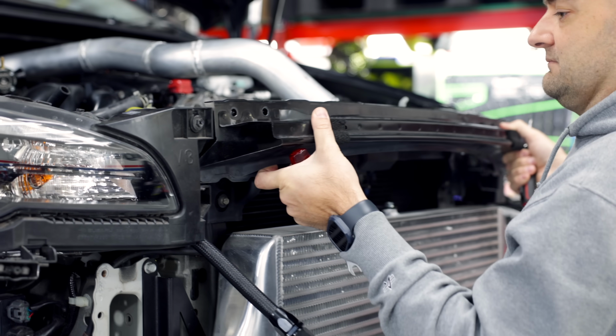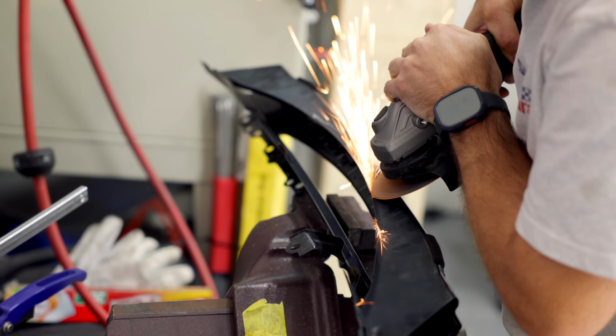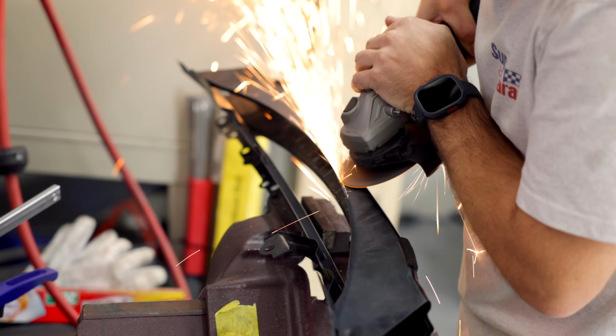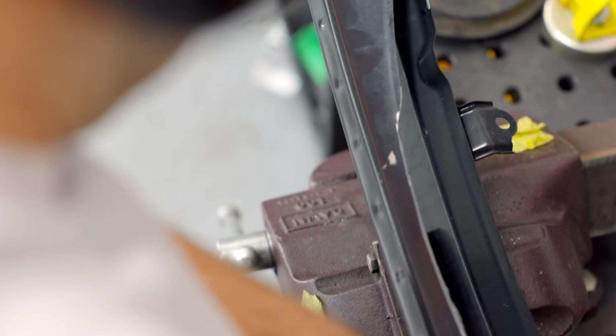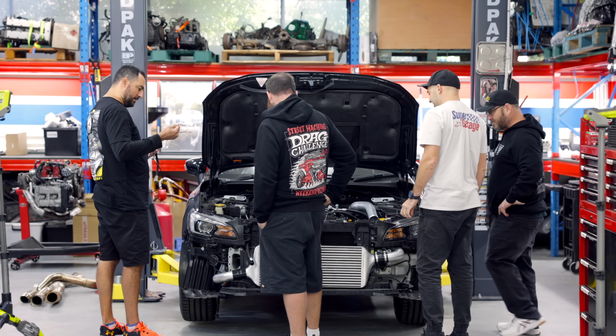We've now got to finalise some of the cooling system lines. We've deleted the factory oil cooler so the water line for that can be blocked off by tapping a thread and installing a brass plug. We're going to use a spare port on the top of the head for a combined coolant temp and pressure sensor. Next, an oil cooler.